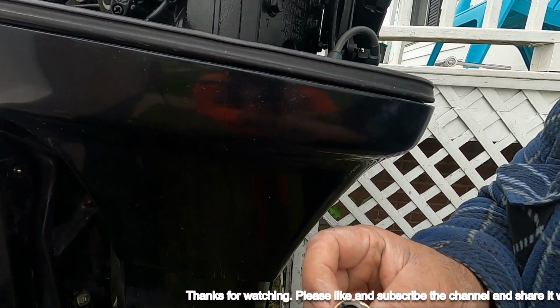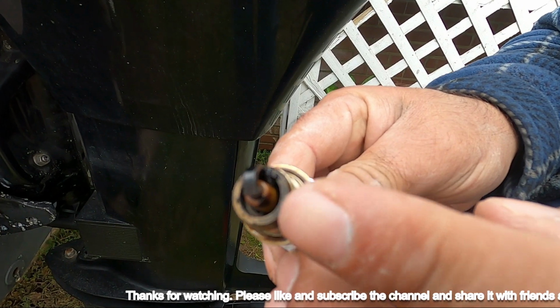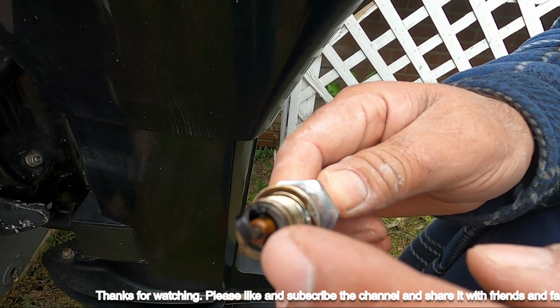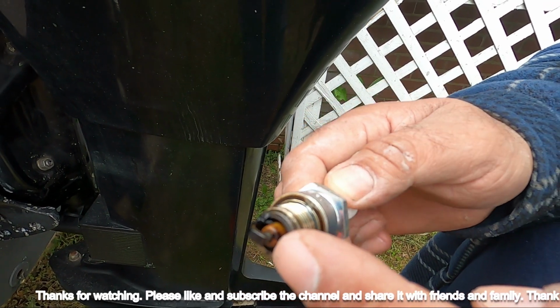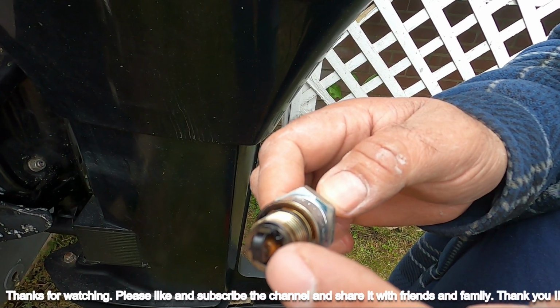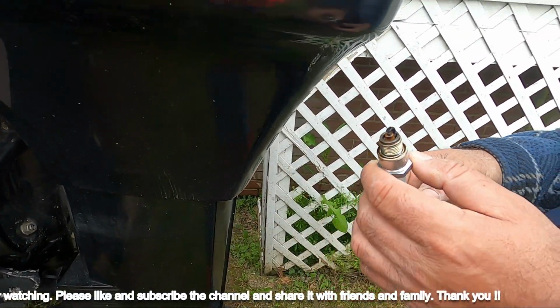So if you see, this is our spark plug, and you see the carbon deposits right there. What we're going to do, as long as your terminal is good and the contact space is good, you can use a sandpaper to clean this up and clean the spark plug and slap it back, and it's good to go. And I'm going to show you how to do that.